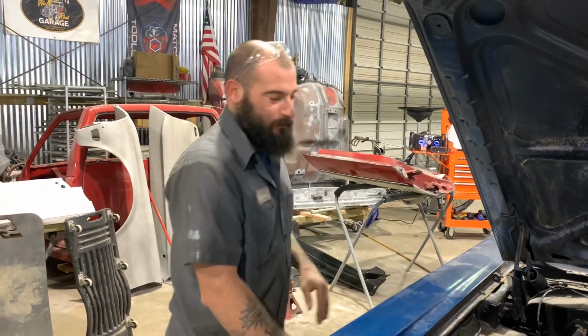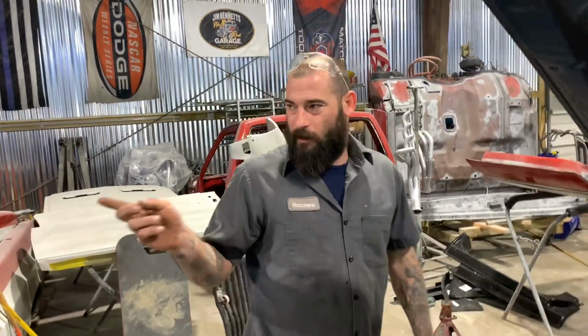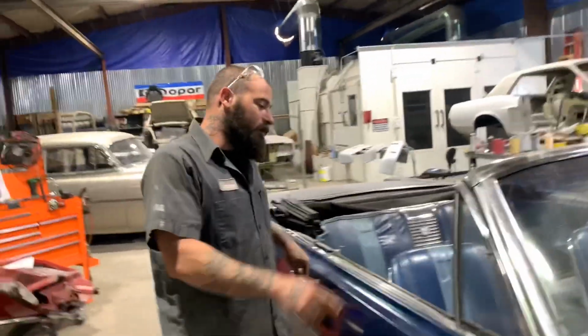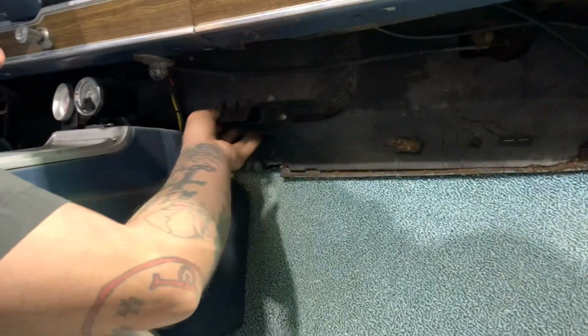He does. All right, so we're back, and you can see we're still holding strong at 15, just a little over 15. Remember the Corvette, Robert's Corvette, the brown one, Stingray, 72. Anytime your heater box is mounted under the dash, you want to check for coolant leaks in your floorboard or anything dripping out of the bottom of the heater box, which would be around here. You'd feel water in your carpet, and you'd see it dripping somewhere out of this heater box. But I think we're good. We're good, brother.